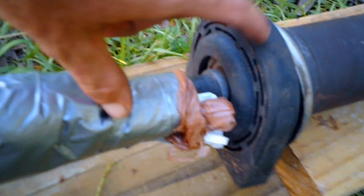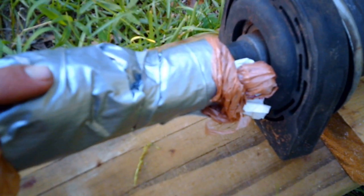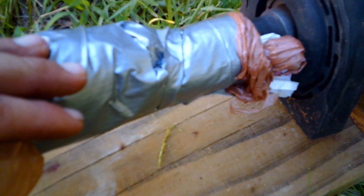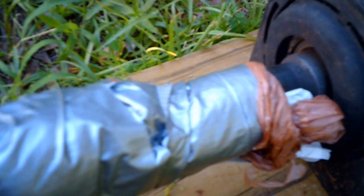Now we've got that outer metal casing peeled out of the way. Before you go cutting and grinding on that rubber and metal on that bearing, make sure you cover up your shaft all nice and pretty — you don't want to get metal shavings all over your grease. It's like a splined shaft with grease all over it that splines into something on the other shaft. You don't want a bunch of metal bits in there, that would be no good. So we get that all covered up and then we'll fire up the grinder and start peeling all that stuff back.